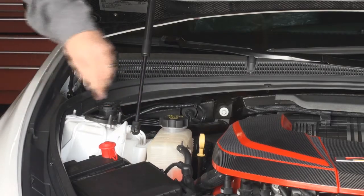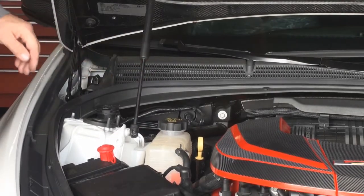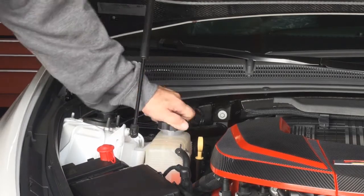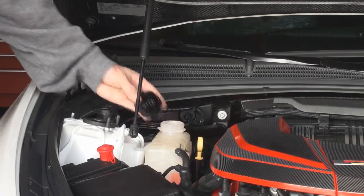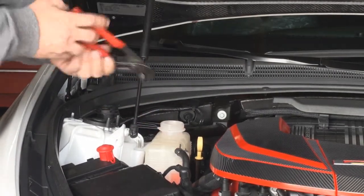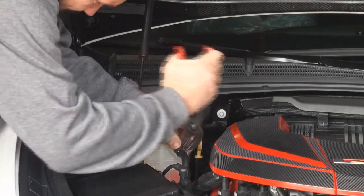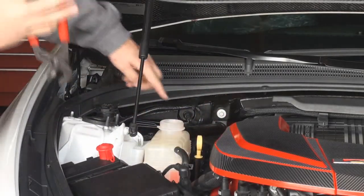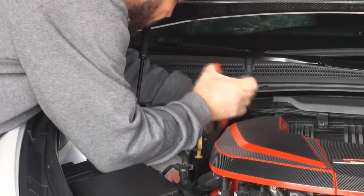It's indexed by a pin here and there's also a pin in the back — basically a stud that sticks out. Of course, it goes without saying you should make sure the engine is not hot when you remove the cap, as that relieves the pressure. Next, we're going to remove these two clamps — they're pinch clamps and they're reusable. Just remove the clamp and slide it down. The next one is on the back side, which I'll show you in a moment.